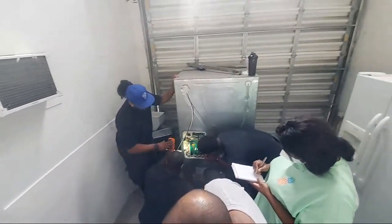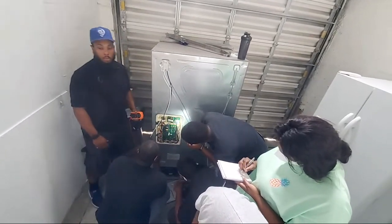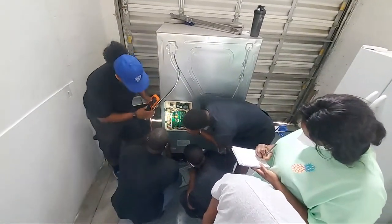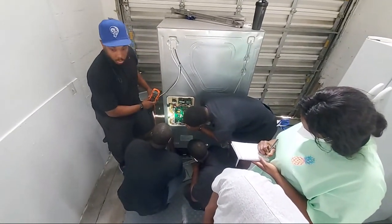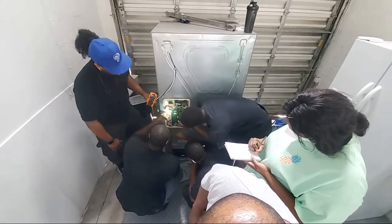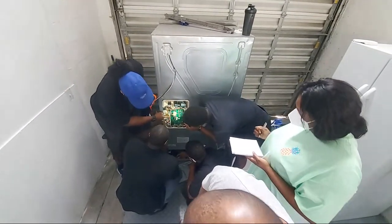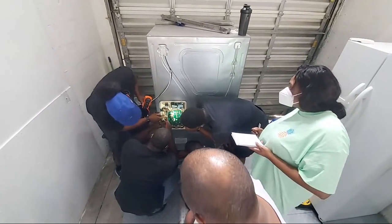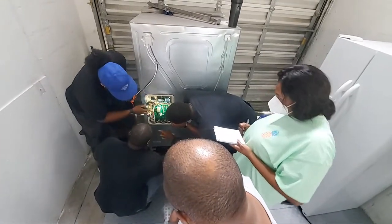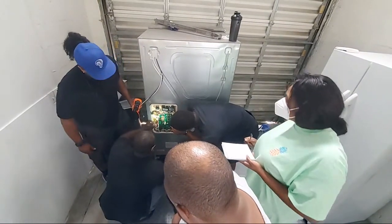CN73. Which one y'all want to do? Fresh food or freezer? Let's do fresh food. We're doing both, but let's do fresh food first. Which one is that, y'all? I just said the answer. R or F? R. Correct. Go to CN70 pin 1. What color is it? White. So that's it.